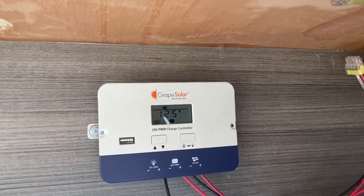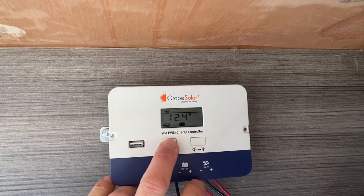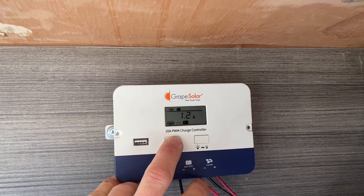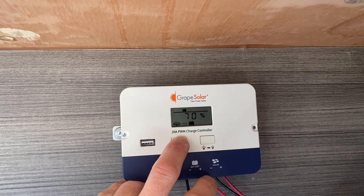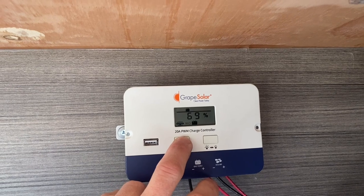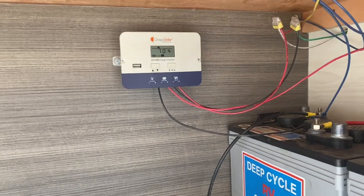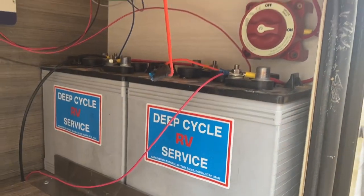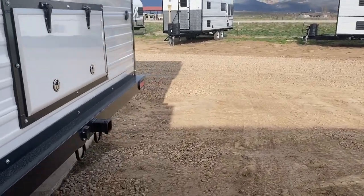As you can see, the solar controller is telling me that my battery level is about 12.5. If I hit this button, I'm getting 12.4 volts into the batteries from the solar panels. That's what I'm drawing on the interior — 1.2 amps — and that's with all the lights on, nothing coming out of the USB port, and my batteries are at 70%. That kind of gives you a good idea of how the solar controller works. You have your battery disconnect — the only time I really ever use that is if I'm working on the electrical side. Most of the time I just leave it in the on position.